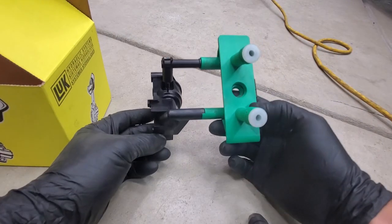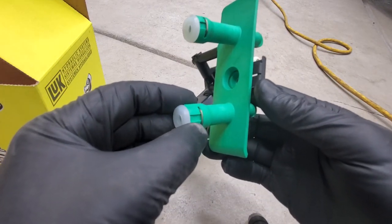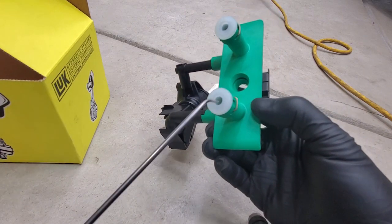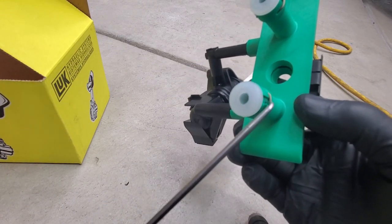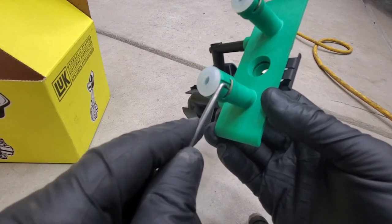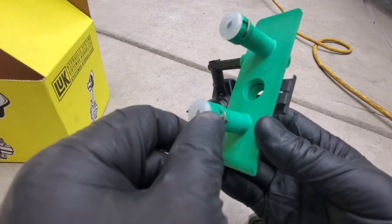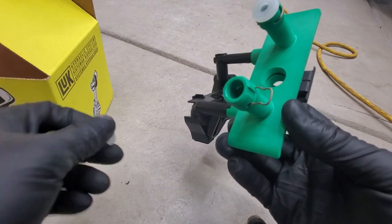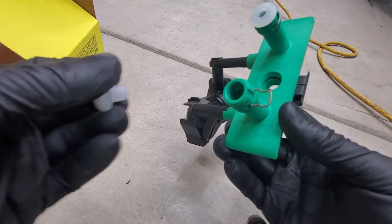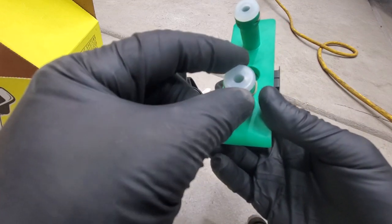Here's the new one — this will be your bottom line, your top. As you can see, you've got these little spring clips that hold the lines in there. What we're going to do is take our little pick and get up underneath the little spring clip. Once you get underneath there, turn your pick towards the line, get down there a little bit more, and then just kind of pull it out a little bit — and that's what releases the line. Be careful because these can fly out if you do it too hard. This just pushes in like that and that's what holds the line in there.